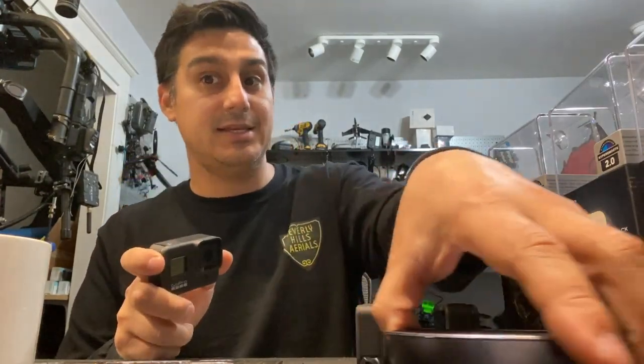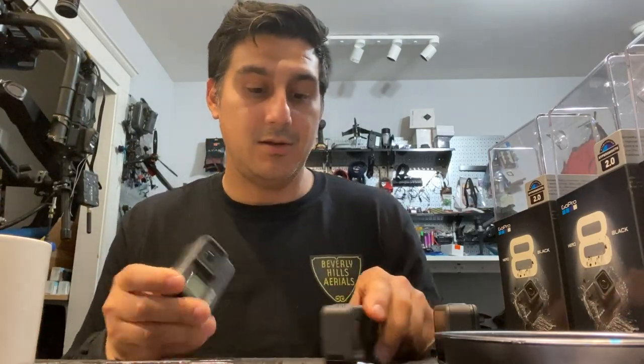And we have tested the GoPros individually, one by one, which means putting in whatever setting you use the most, hitting record for 30 seconds, a couple minutes, changing settings, hitting record, looking at the native colors, the pro tunes, and just making sure that everything's working right. Although it's not super common, we go through our share of GoPros throughout the year, and I'd say at least once or twice a GoPro out of the box does not work. And it's a shame if you take a brand new GoPro and use it on a professional shoot or spend several hours decasing it, and then you find out that the GoPro never worked from the beginning. Would be a shame.